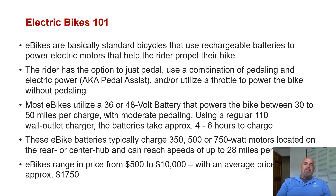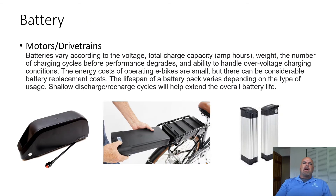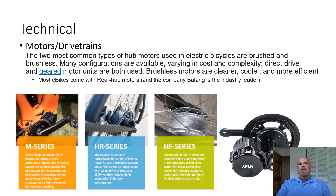Normal physics are in place and we're only talking about 65 to 70-pound bikes typically, so those normal conditions — wind and slope — can really affect some of the metrics. Bikes range from $500 for your Walmart special to $10,000 for a fancy Buell or Stromer bike with custom configurations, carbon fiber frames, and fancy new technology in the motors. A typical bike is around $1,500 to $2,000. Here you're seeing common configurations of the batteries. Here you're seeing two really different motors — the rear hub motor is the most common. Those two in the middle are Bafang rear hub motors, the most common in the space. The two outside images are examples of center hub motors.